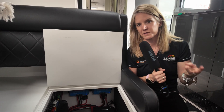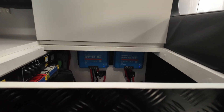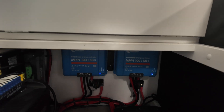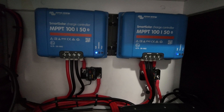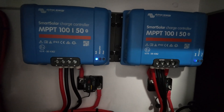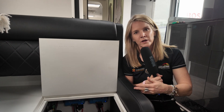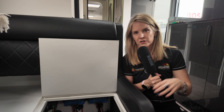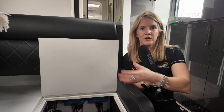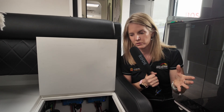Our third way is from solar. We've put solar panels on the roof of this one. To do that we have two solar controllers in here. The reason we go two is if we have to put different size panels on the roof — so if I've got a 190 watt panel and then an 80 watt panel with multiples of those, I'll run them into different solar controllers. All the 190s will go into one and all the 80s will go into another, so we quite often use different size solar controllers.